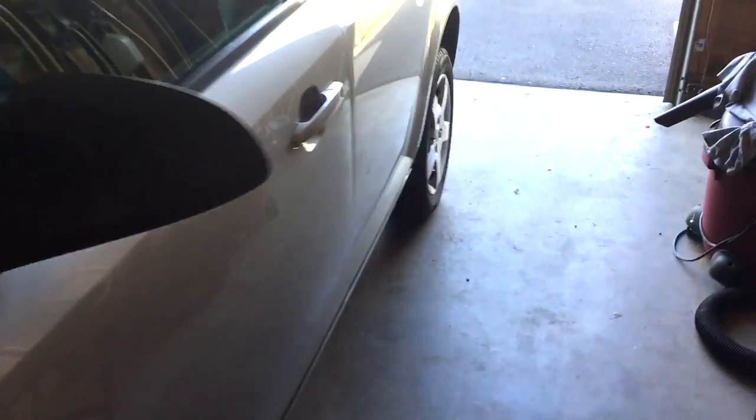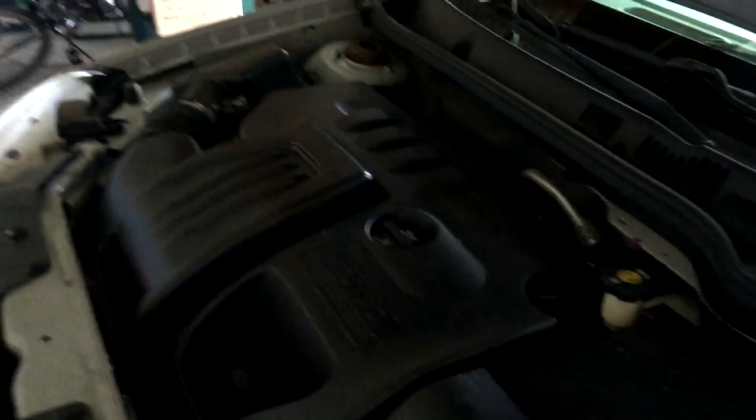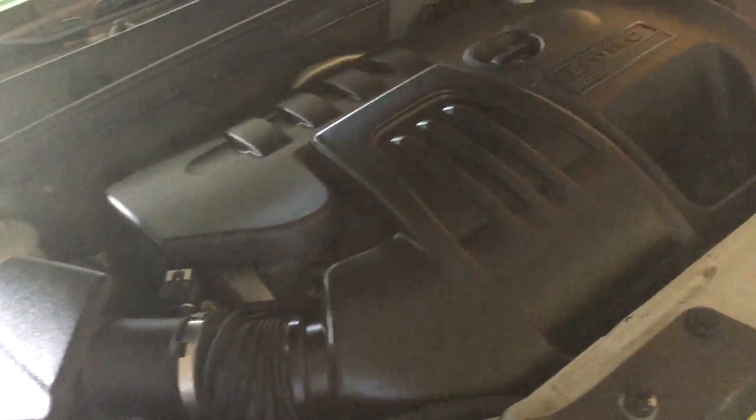Sorry I'm a little out of breath. One thing you have to be careful with on some cars — the doors may not open properly while the car's jacked up. You can hear this door squeak and feel a little pressure on it. Another trick: this engine bay has been detailed — very clean under here. Also, drive the car for a good 10 to 20 minutes before doing an oil change, because when the car is warm the oil comes out a lot easier.